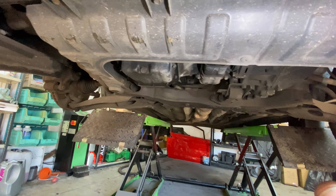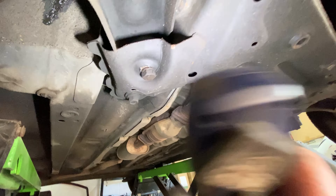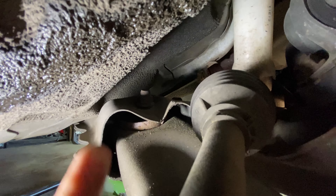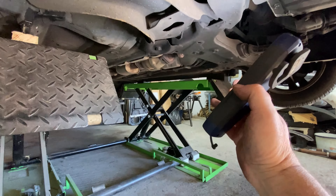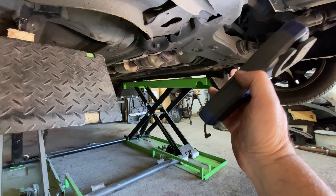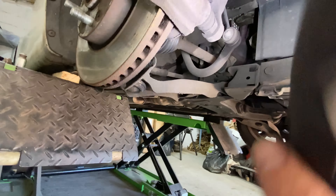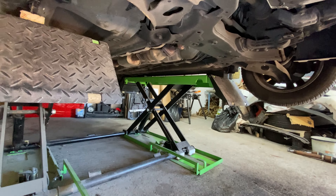I'm not quite sure on price or if I can find one - it's an unusual car, it's an iX20. I'm hoping I can find one on eBay or from someone breaking one of these cars. The steering rack is connected by four bolts - two there and two here - so you just undo that and it comes down. It's not that bad actually. But that's our issue guys - that subframe definitely needs to be changed, there's no way it can stay up there. Look how bent that bolt is - it's twisted.